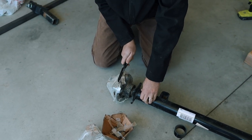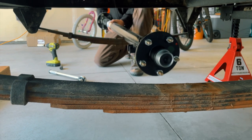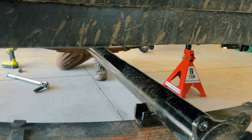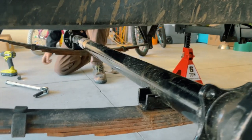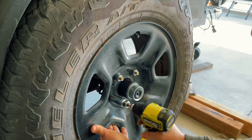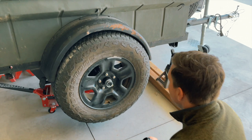One of the things we wanted to try this time was to un-flip the axles — basically put the axle where it was meant to go, which is on top of the leaf spring instead of on the bottom where we had previously put it to give Hicks more clearance. We thought that by un-flipping the axle we could lower the center of gravity and help prevent a future rollover.